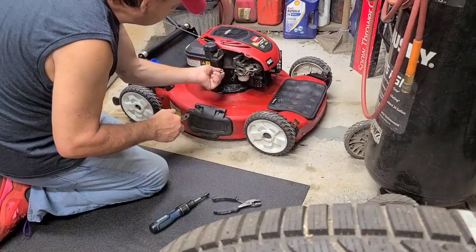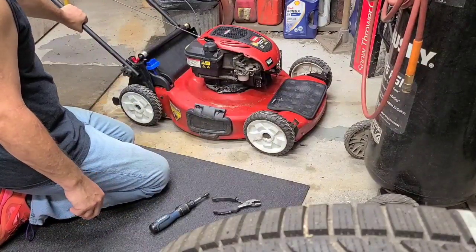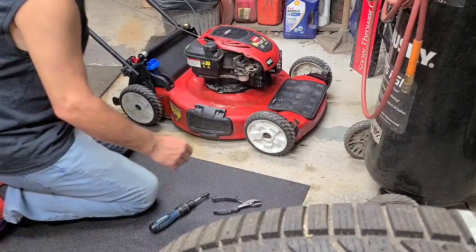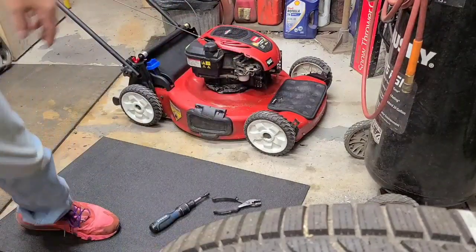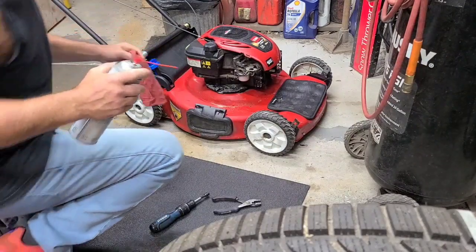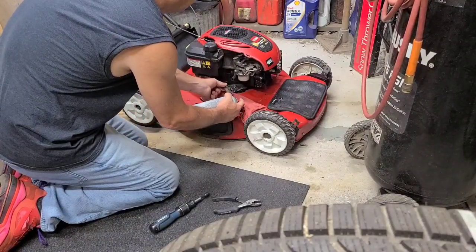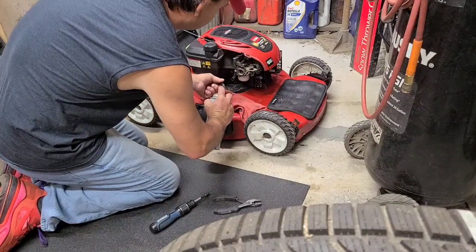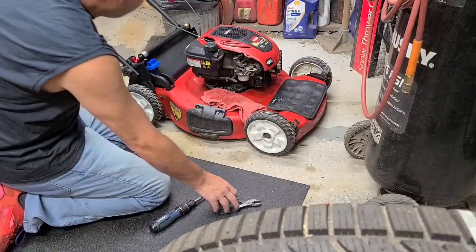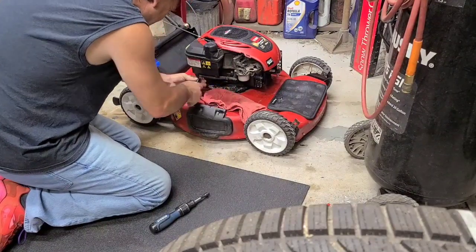Ooh, that's always a good indication. It's snowing out the fuel line. Great. I'm guessing water intruded into this carburetor badly. Get a rag and some brake cleaner. I'm gonna sit down and at least get the start to flush the line out. Yeah, when you see that white powder, it's aluminum. Aluminum powder. I think I can pull the line right off. Maybe.